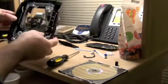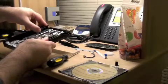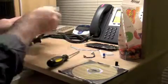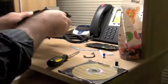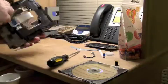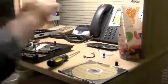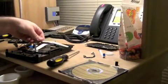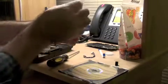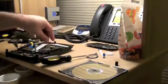Put your little plastic arms that lift the transport up — put those in. Snap it until it clicks, same with the other one — slide it until it clicks. Turn the mechanism over. This little pivot arm — put that back in. All you need to do is make sure that these two catches go into the plastic arms that you just installed.